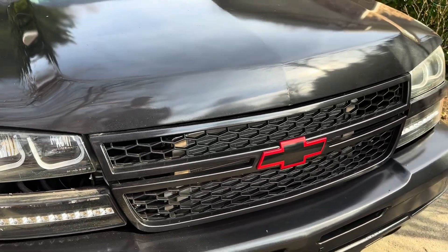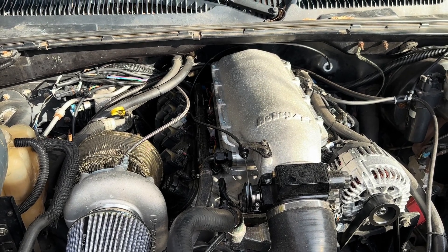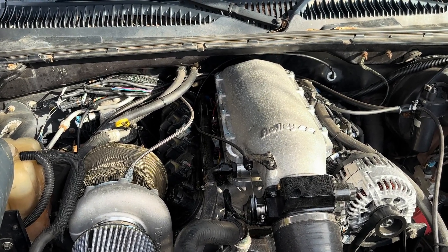We're heading over to look at this little turbo truck — it has a little water leak on it, a project I did a while back. I suspect it's probably going to be the heater connectors at the heater core, because that's usually what leaks on these trucks. That wound up being a simple one — one of the steam ports on the back of the heads on the LS motors. His has aftermarket ones, they're bolt-on, and one had vibrated loose over time. We found it, diagnosed it real quick, tightened it up, charging $30 for coming out — simple and easy.